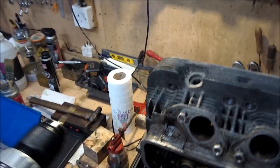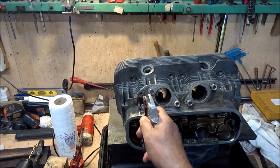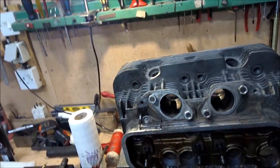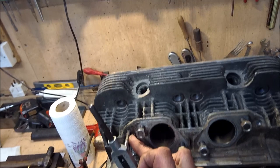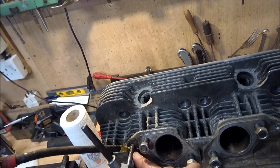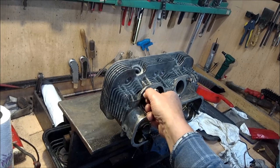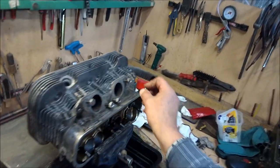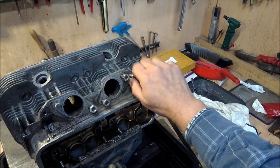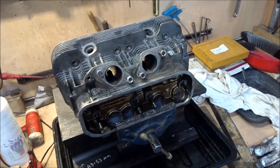That little bit is broken out of there now - let's have a look at what we've got. That's looking pretty tidy. I think we're going to tap that now at M6 - remember there might be some little bits of iron thread left in there. The screw just winds in nicely. Check the other one while we're at it, which I have cleaned out. So that's that little job done - maybe we'll be able to move on to the valves and valve springs.